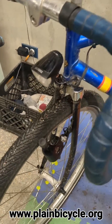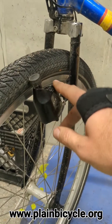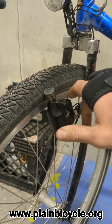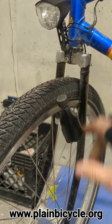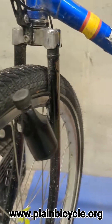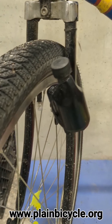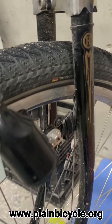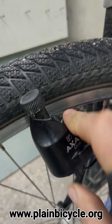It does generate a little bit of resistance - you'll definitely feel it once you've got this connected. The hub dynamo you can't turn off. This roller dynamo I like because you can just fold it off. So if it's daytime or you don't want to run your lights, you can just pop that off. And then when you're ready to ride - pow - you're good to go.